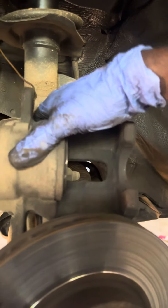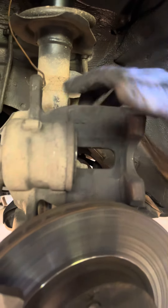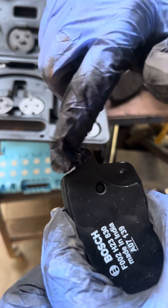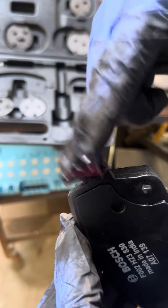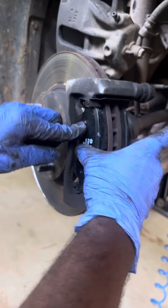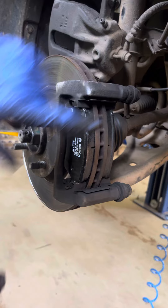Now the piston is complete and we have to assemble it with the new brake pad. We have to grease it at the edges. Next time we remove it, there may be rust formation, so we have to fix it correctly. Once it is finished, we place the caliper.